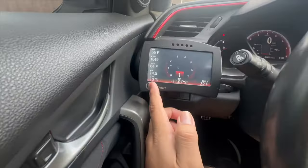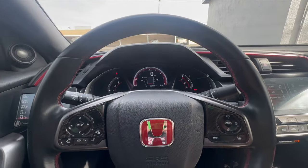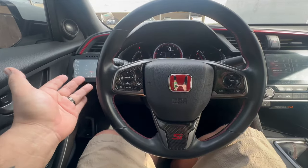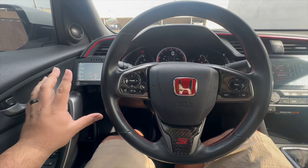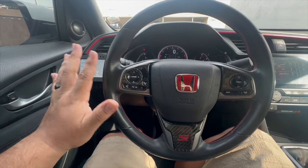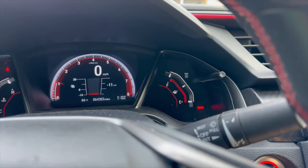I have about 12-13% more ethanol. I did drive it to work the other day, so hopefully that's enough for me to fill up with 91 so we can start the upload going. Pretty much when you're starting new with a flex fuel tune, you have to do everything from 91 or 93, depending on where you're at. We need to get all the knock control, the air fuel ratios, everything pretty much ready on 91 so we can make sure the car performs really well. And once however many 5, 6, 7 revisions are needed to ensure that tune is good, then we move on to an E30 or E35 tune. I'm going to go fill up a little bit more on 91 and we should be good.